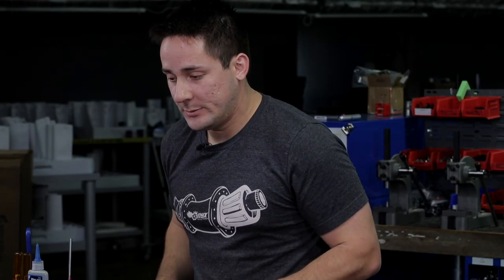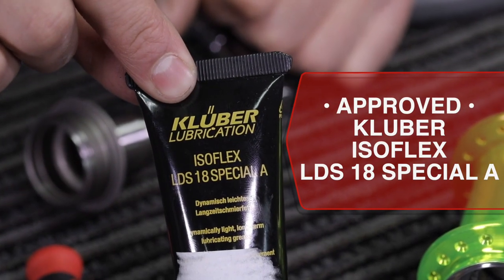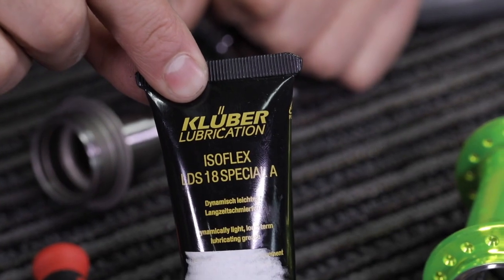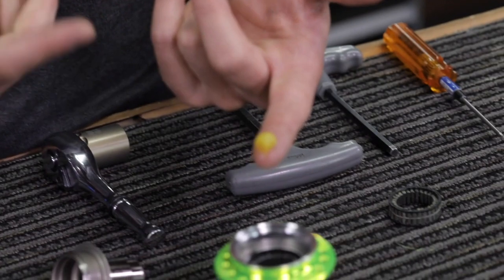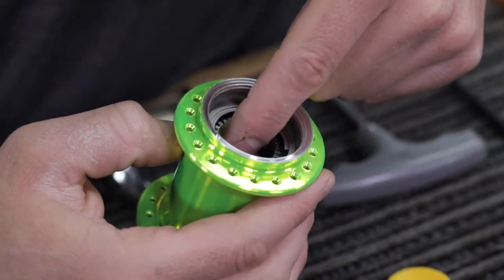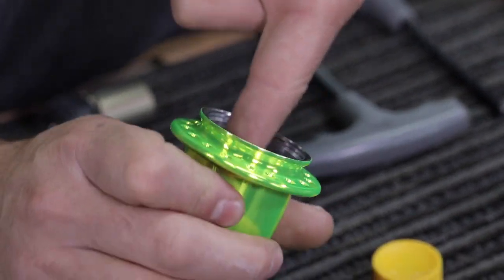At this point, you'll want to re-grease the sprag clutch using the Kluber Isoflex LDS 18 Special A grease. This is the only approved grease for Onyx Racing Hub products. This grease has zero Teflon, PTFE, or any lubricating additives, which will keep the clutch from slipping during high load. Greasing the clutch takes a very small amount — less than 2 grams of grease per clutch unit. This can be pushed into the clutch and lightly spread around. The install of your freehub body will spread this grease to the appropriate locations.